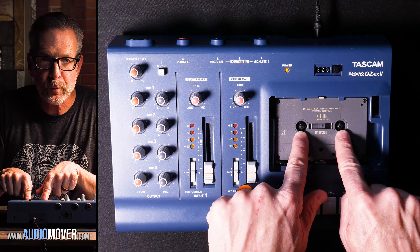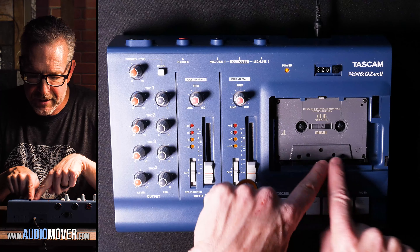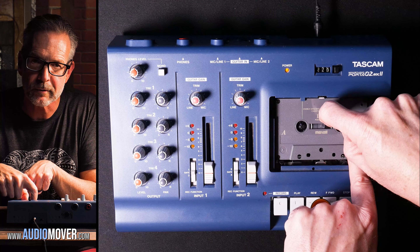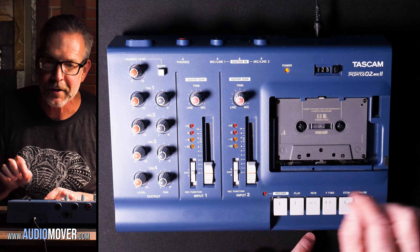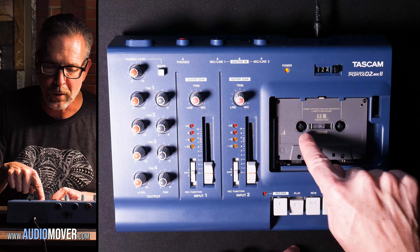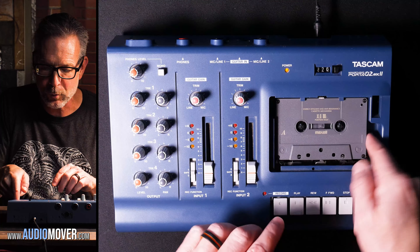The capstan is managing the speed — that little piece of metal is always spinning at the same speed, and that makes sure that as the tape goes across the head it is always going at the same speed. These take-up and supply wheels are doing nothing but creating tension so that as the capstan and pinch roller push the tape through, the wheel grabs it and pulls it on consistently. The wheel is not creating the speed, because as you see, this wheel is constantly slowing down while the other is constantly speeding up.